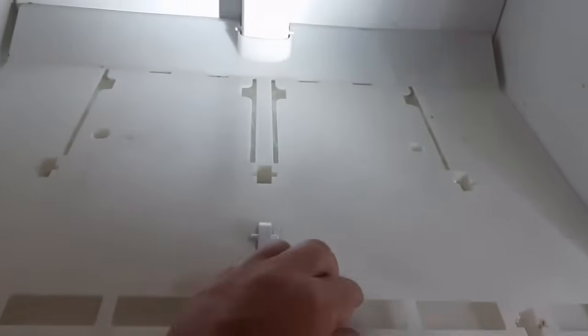So this whole tray here just pulls up. Oh, and you can hear it's kind of crispy, so you can hear the ice under that. And then it just pulls out. Out it comes. And you can see there's a really good sheet of ice. There's a chunk that actually started coming out. So this is all iced over. And I'll show you the blockage. The blockage is right here. There's a hole there, and if I feel that hole, it's completely iced over.